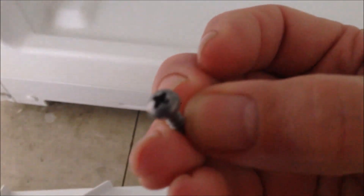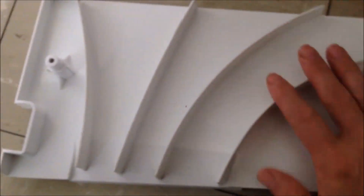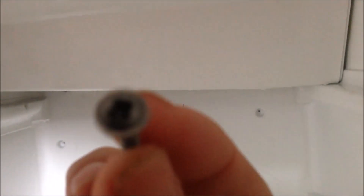Here I have removed the lower panel. The lower panel has two smaller head screws — stainless screws — and two holes. This is the guide for ventilation to the lower part of your freezer, installed like this. You can see there are two screw holes over there. There is also the upper cover, which is for the evaporator, and it uses a bigger head screw with a washer.